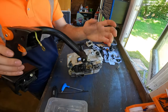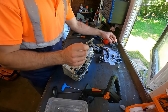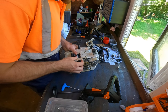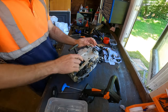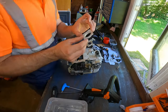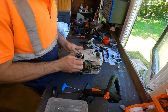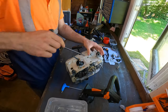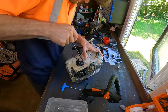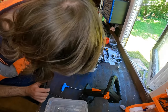So we've got the screw that's already in there. Take this bit of paper out. We can put our boot on. It lines up, there's a line on it, make sure that lines up with the line on the tank. Got our clamp, we'll always put a new one on this because the clamps do get worn. A new boot as well, and I'll use this just to push it into place. There we go. Check underneath, make sure, yeah, that's all nice on.